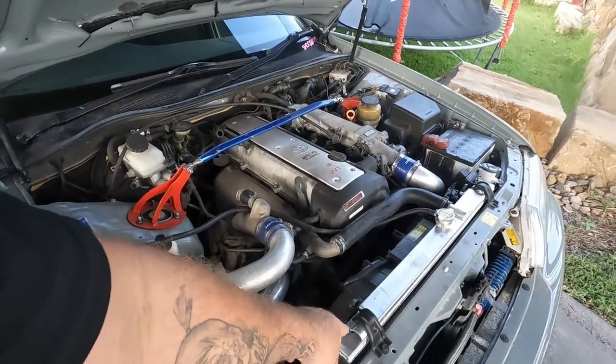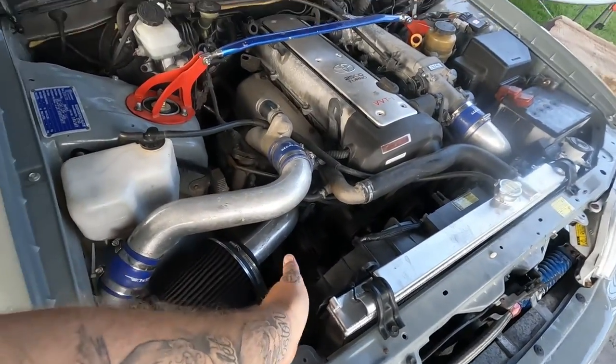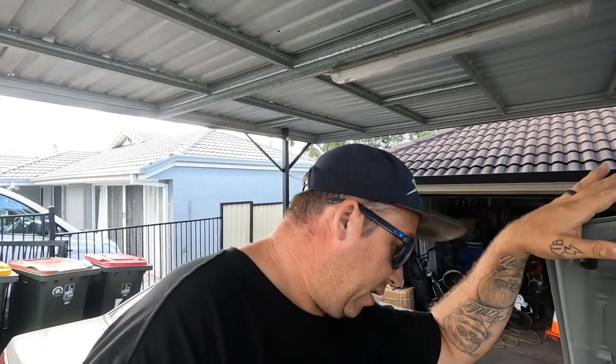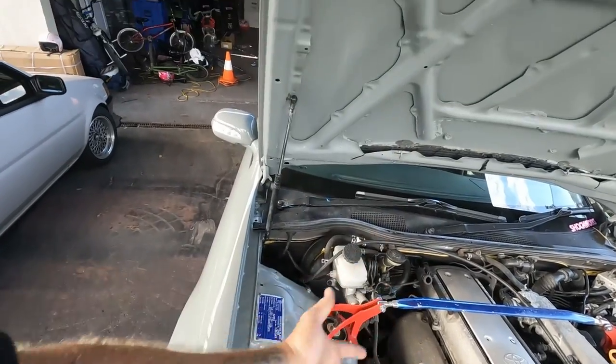You know what I was talking about earlier — the stuff that I filmed but then lost the footage. We've got the dump pipe, which you can't see from the top here. The other thing we did is go ahead and get an aluminium radiator — just an eBay spec aluminium radiator. As far as I'm aware, it's made a really good difference. I took the thing drifting yesterday and temps are actually colder than driving it with the AC on daily. So I think the cooling is really working quite well. The fans could be better — they overhang and probably aren't as efficient as they could be — but overall, pretty happy with progress on the 100. Big alloy rad. You can't see the dump pipe from the top, but it's a full dump pipe in there, and it makes like an extra 2 psi of boost because there's just more flow.